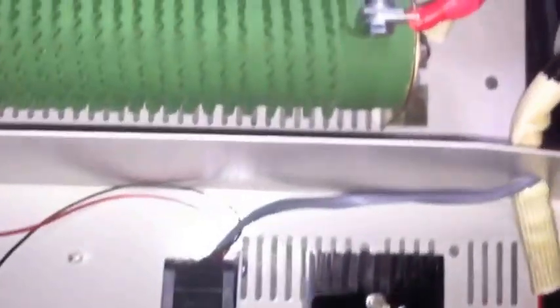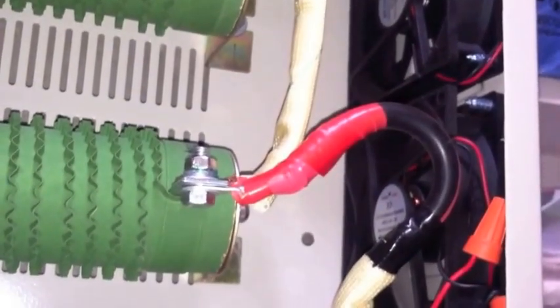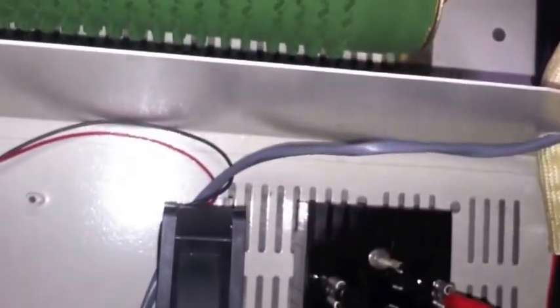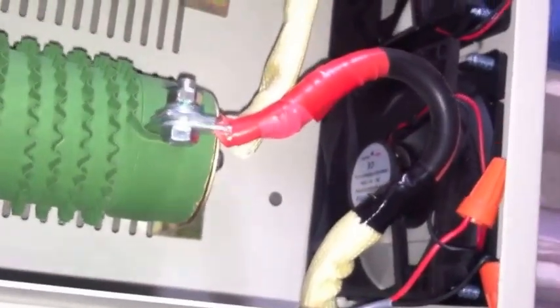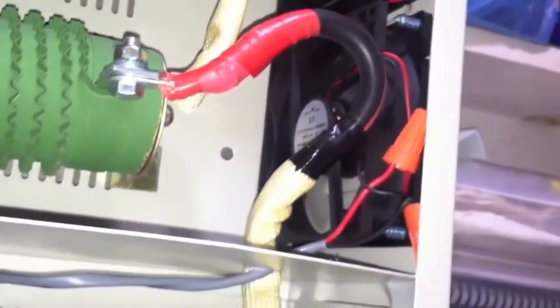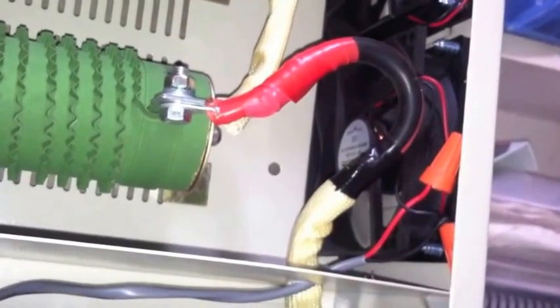I found one very interesting thing while hooking these 12-volt fans up, which I hooked right into the 12-volt auxiliary input. I have all three of them hooked up, turned it on, it started up and then it died down. So I started disconnecting fans — did the same thing with two fans. I went from two fans, did the same thing, and now I'm just running one fan. I'm guessing that's too much of a load draw on that particular input. If anybody has a workaround on that, let me know — I'd like to get all three fans going, but right now I have just the one.